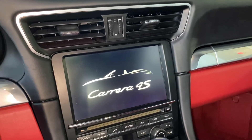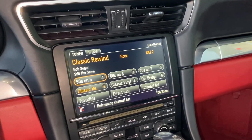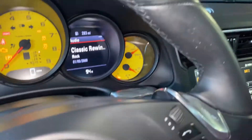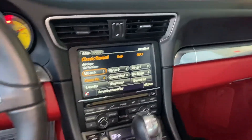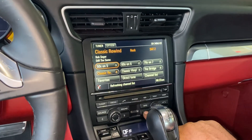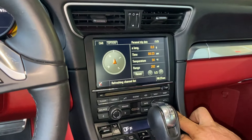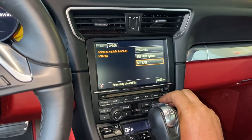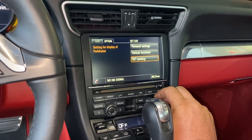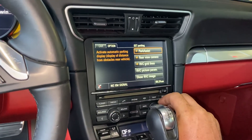On a real live example, it took two attempts. Right now it's coded. I'm going to depress the switch, pull this off, and I'm done with the coding. Let's go back to the Car Options menu to verify that it did indeed code correctly. Car Options — we do have park assist grayed out, and the camera menu is present.